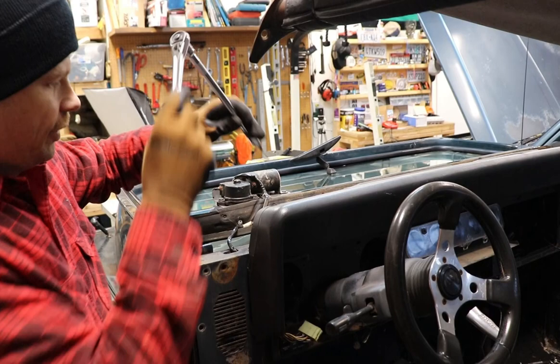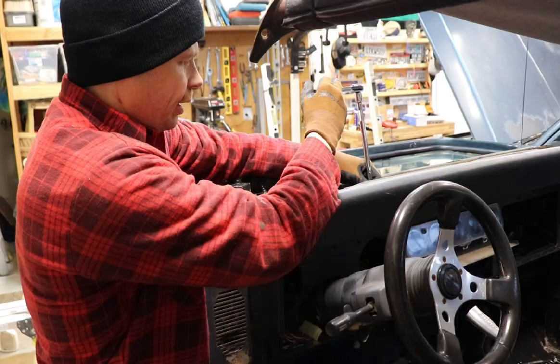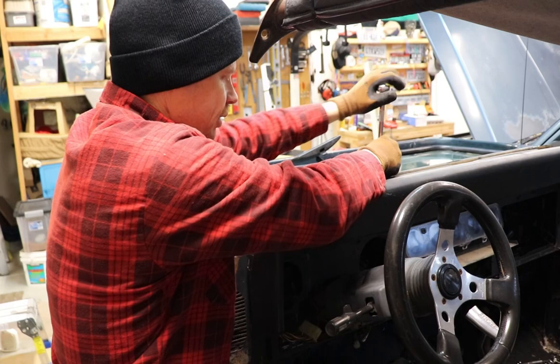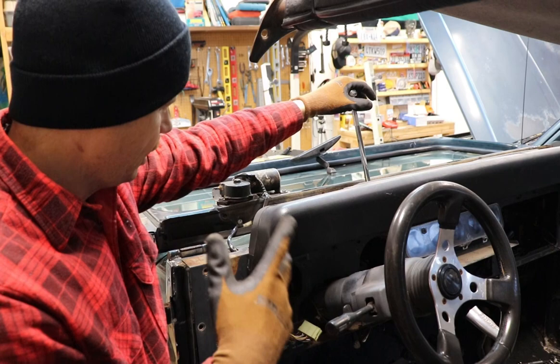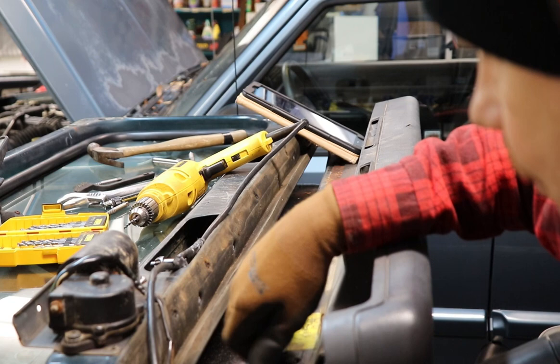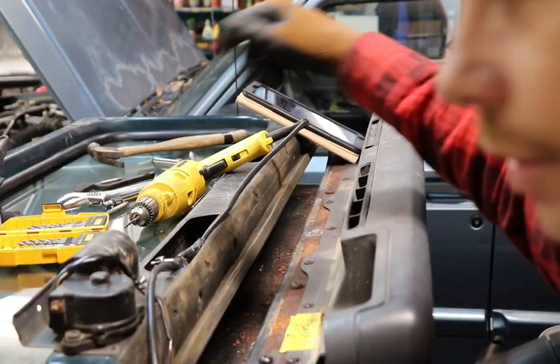As far as drilling out these bottom four bolts — I know I'm gonna get some comments saying you don't need to take your whole dash apart, you're wasting your time. And yes, maybe so, but there is so much seam sealer built up back there, and I want to scrape a lot of it off and get my new fasteners in there real nice. Taking some of these bolts out, this is coming apart fairly easy. There are five bolts all across the top here. I've got four of them out no problem. The middle one here is giving me trouble, so I'm actually going to drill it out and use a screw extractor to pull it.